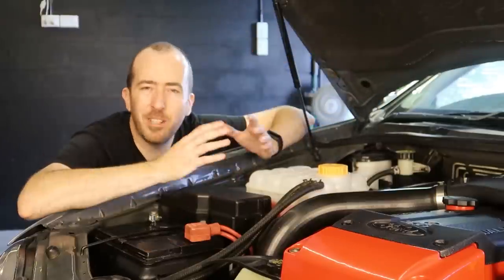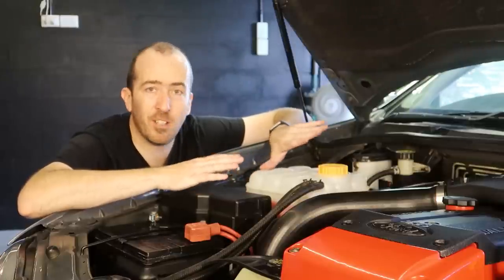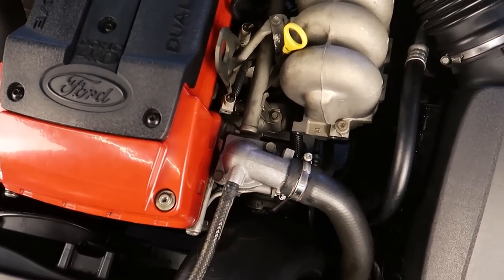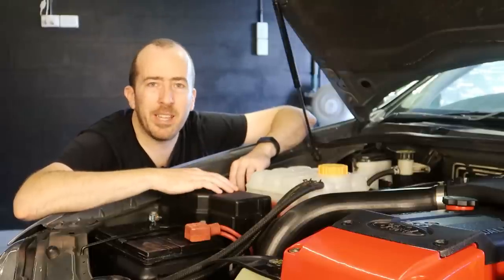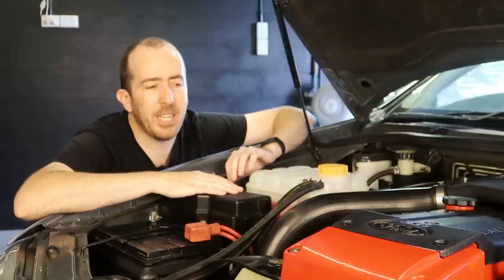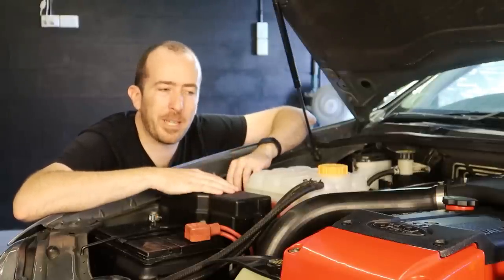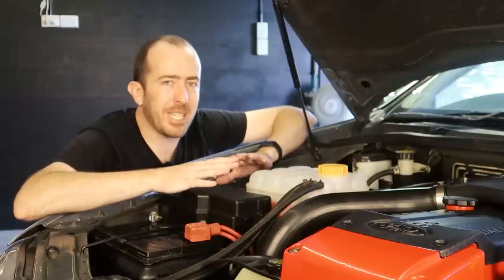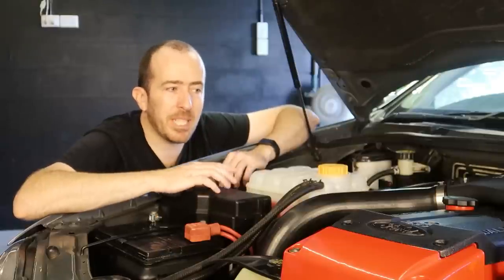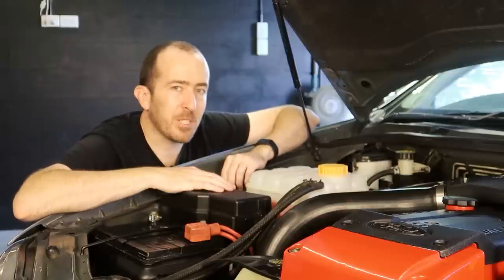I do know that some of you are going to have a go at me for not flushing out the heater core, but honestly the rest of the coolant looked pretty good in this thing. And I have been running the heater a lot these days considering it is winter, so I think it's going to be all right. In the weeks ahead, you are going to see me under the bonnet of this thing a few more times because this car has actually developed a bit of a misfire. It only happens at idle — when you're above about a thousand RPM this engine runs beautifully, but it stutters at idle or low RPMs and you can hear the exhaust popping a little bit. After a couple of Google searches I've narrowed it down to possibly the coil packs, and the original owner mentioned the spark plugs were due for replacement. So I'm going to get new spark plugs, new coil packs, and a few other things, which I'm going to save for the next video.